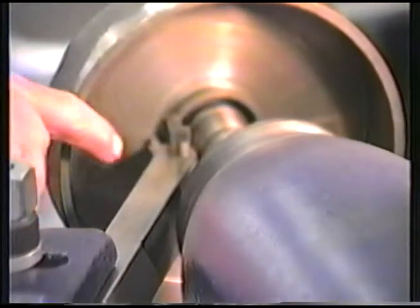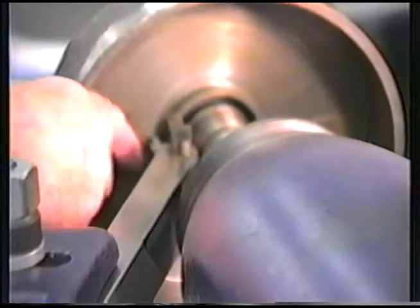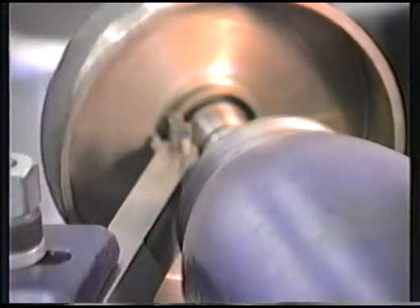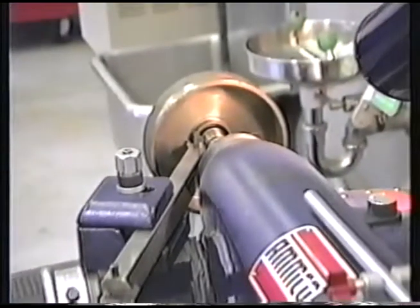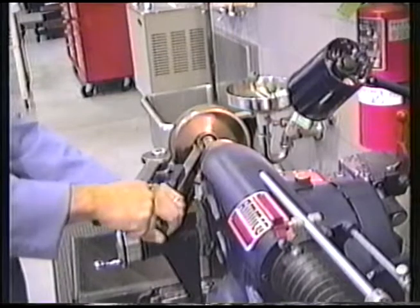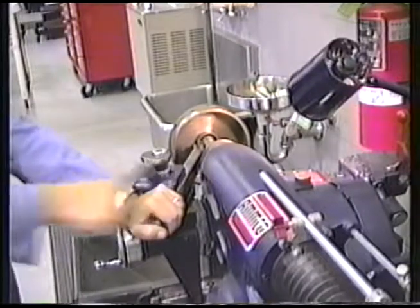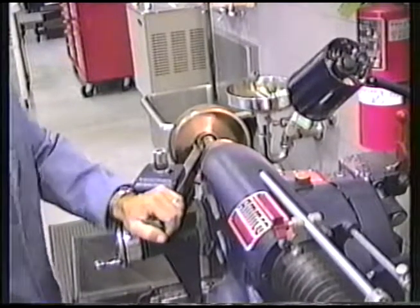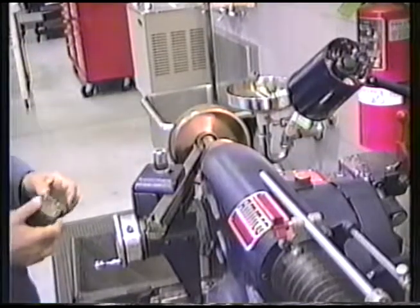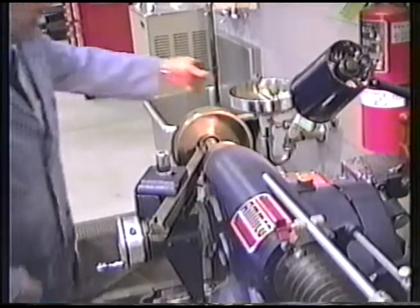And we have to bring the cutter up all the way against or almost touching the hub surface of the drum. And it, in fact, will cut that entire surface. And it's now approximately 50 foot-pounds. Just hold onto the bar like so without moving it and give the wrench a good pull. That should achieve about 50 pounds of torque. Also, it will be necessary to silence the brake drum while machining it. That's to keep it from ringing or vibrating.